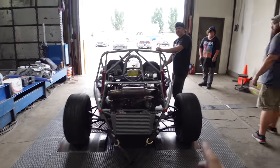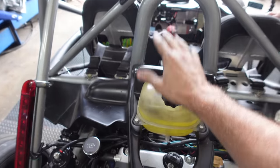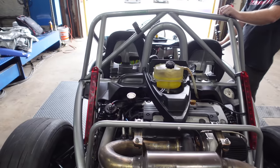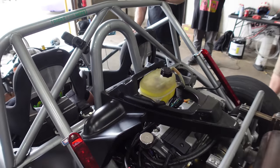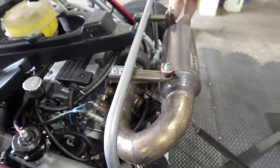After a quick intermission and a Gordo run to Harbor Freight, we sucked the cooling system down with the vacuum tool and at least we hope got all the air out of the system. The hoses were crushed, which is a good sign. And Jamie was like, it's not enough wastegate spring either for a race car. So we threw some more in there.